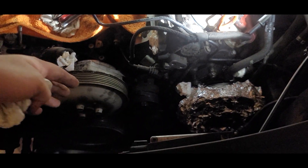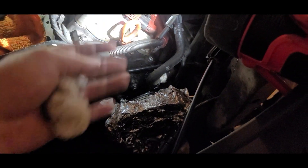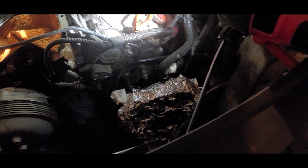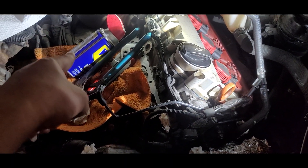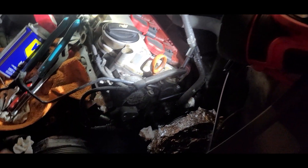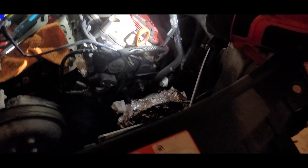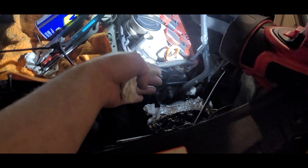I can also change the timing belt — you don't have to move this back to service position to move the timing belt, you can do it without it, but it's easier that way — and also for accessing the hoses. Just as a reminder, if you're going to be removing the hoses, use WD-40 and a flathead: spray the hole, then use the flathead to push it out and it comes right off. It took three to five minutes.